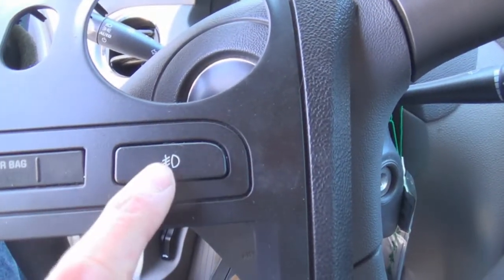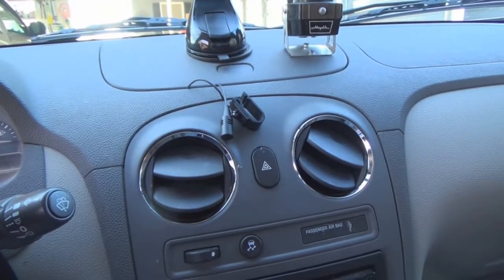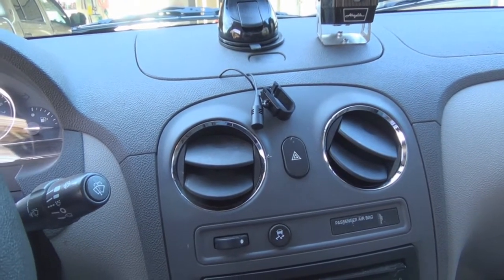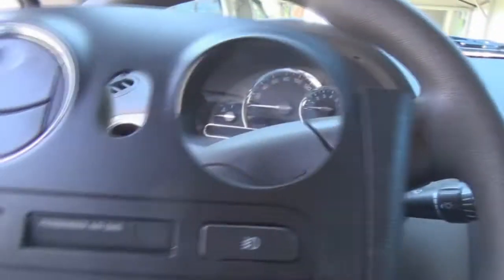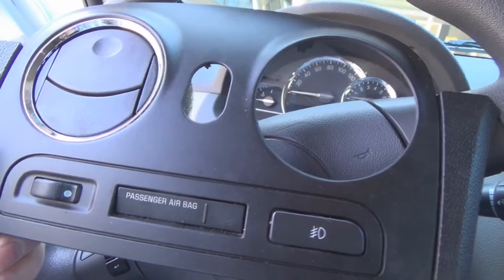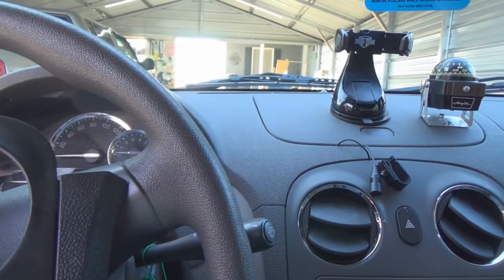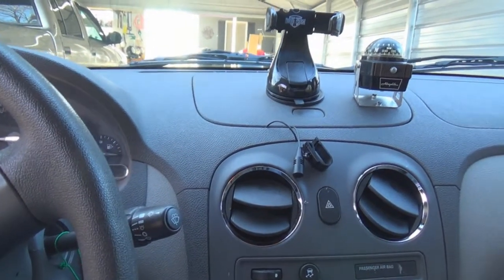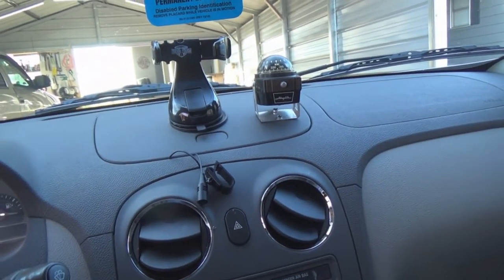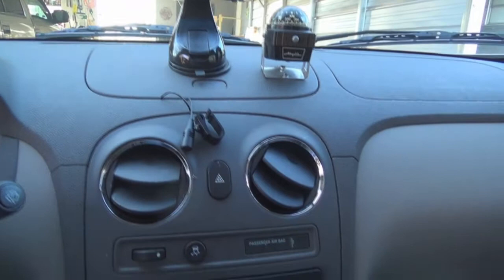This panel had the switch in it for the fog lights, and the wiring was in the dash for the fog lights on this car, but there's no wiring beyond the fuse box. I actually had it all plugged in and couldn't get it to work. I did some tracing, and the wires didn't go all the way down to the front, so I ended up wiring my fog lights so they come on with my high beam lights, which is appropriate because that's about the only time you'd want to run them. That works out just dandy.